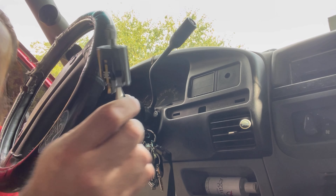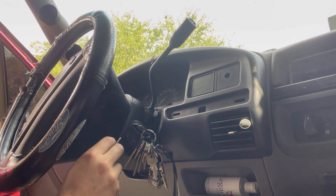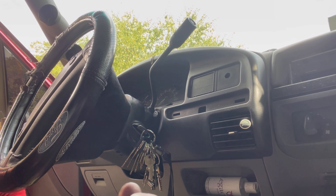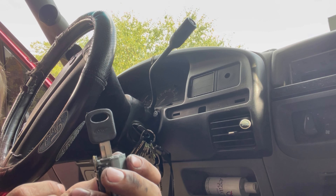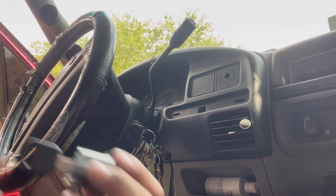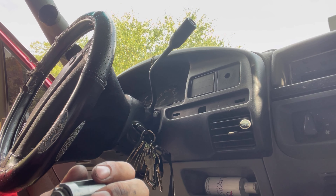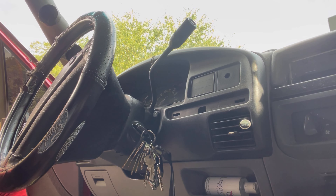It comes with two new keys and everything. I got mine from my local auto parts store. I got the top piece back on, the bottom piece screwed back in, and that's pretty much it. It's not hard. Like I say, if your switch is broken like mine was, sometimes it can be a pain. I tried pliers and then tried a pick — the pick finally worked, stuck it inside the key switch and got it kind of angled and was able to get it to come out. You can do it with the batteries unhooked too. Pretty straightforward.